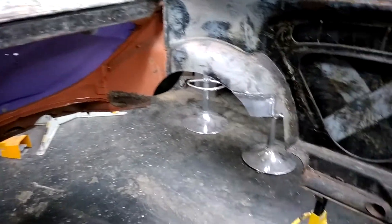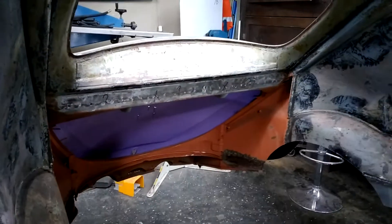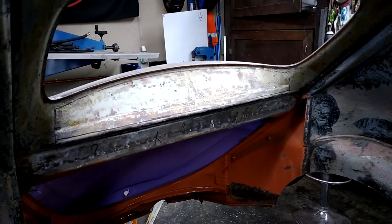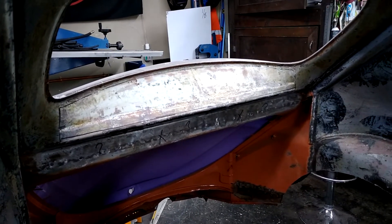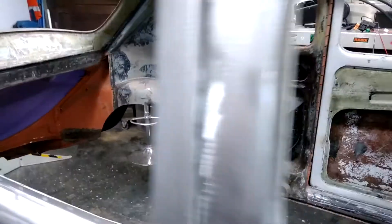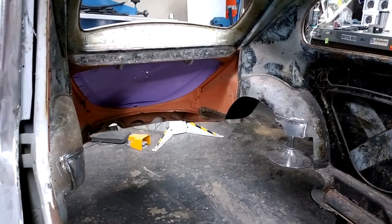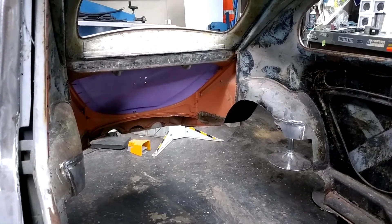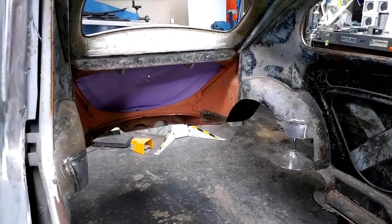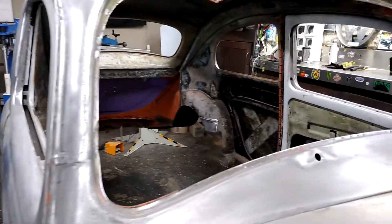I had to do a little patch panel rust repair on the fenders there. Then I'm going to cut a panel back there and fabricate a new panel that's going to bolt in and bolt out underneath the back window so that I can access the vents and maybe put a cold air intake back there — that's kind of where the motor goes in the back. You just cut it basically on the spot weld seams and get rid of all the spot welds. It's actually fairly easy, especially because this is a 20-gauge car. I did a lot of it with my Sawzall and it came out real quick.